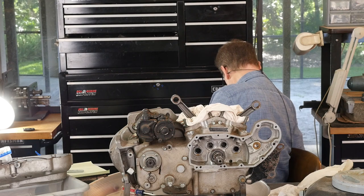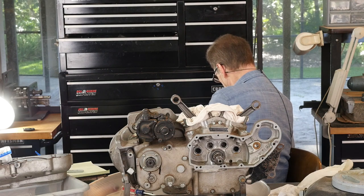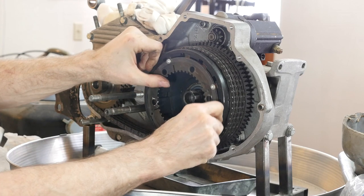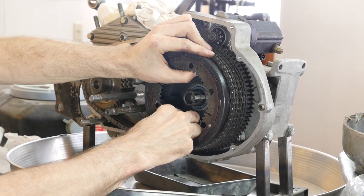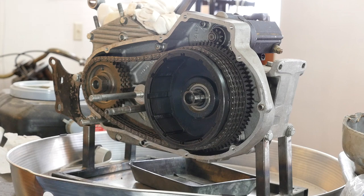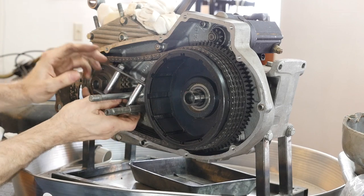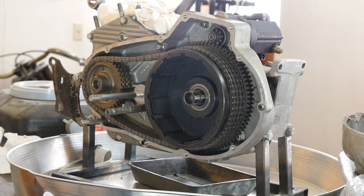I rigged up a homebrew puller for that. I've got a drawer of special Harley tools. This is a homemade for the dry clutch; this is the wet clutch version where you put this in here being screwed together, and it allows you to tighten stuff, do stuff. Then the other special tool — with an impact you really don't need it. There's this homebrewed thing — they sell it as a special tool though. It works on the early models where you use this to freeze these two so you can use a regular torque wrench, which would be the smart way to do it. I've always cheaped out and just used that impact.